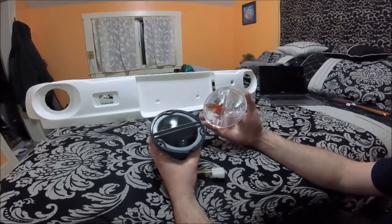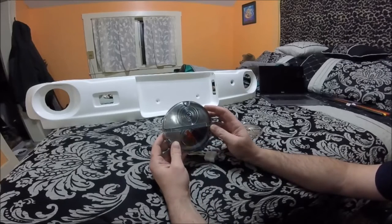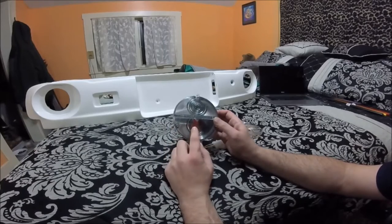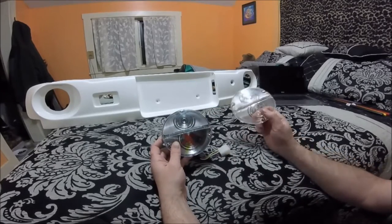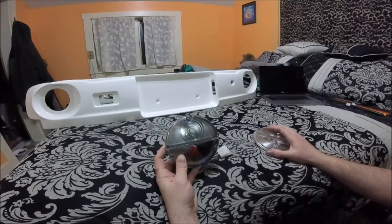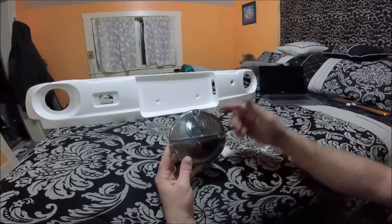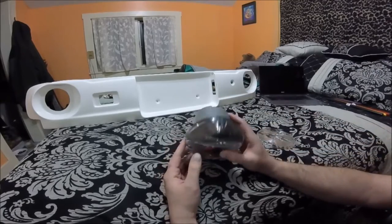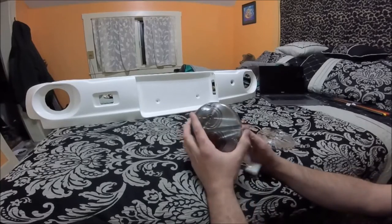These are reproductions of a tail light from a K truck from Japan called the Mazda Porter Cab, and those lights are discontinued. I couldn't find anywhere to purchase them online - they come in just the standard red and amber. There doesn't appear to be anywhere to buy them online, and there isn't a whole lot of options for a 5-inch round light to use with this panel. Some forum searching turned up a pretty decent option from Hella that could work out. Also, some people have put Corvette tail lights or lights from other makes and models that have a single round light, and there are some LED light options online as well, and everything else seems to be much cheaper than these lights.